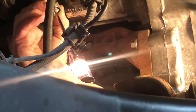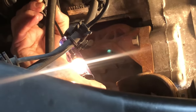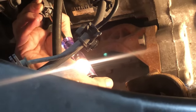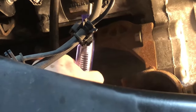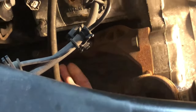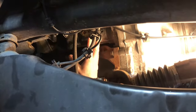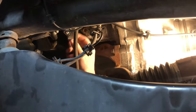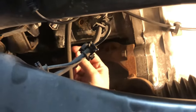You see how it lit up? That means the signal coming from the key is working, and the problem has to be in the starter or in the ground. The ground is grounded to the motor — the body of the starter is what collects the ground. So we had a problem somewhere between the power and the ground.